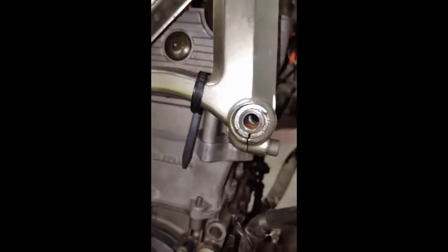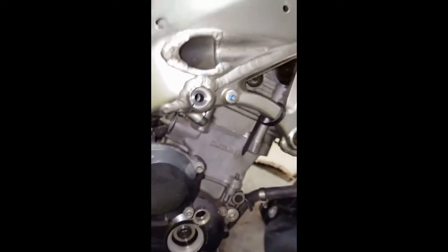A quick note: when you're installing the cam chain, you want to pull all the slack on the exhaust manifold side — pull the slack up and around your camshaft to get all the slack out, because you want all your slack to be on your tensioner side, right here. I'm going to clean that gasket up later and install a new manual tensioner. Once you put your intake cam on, there will be a lot of slack on the intake, carburetor side of your chain, which the tensioner will take up.